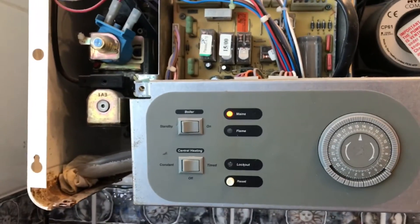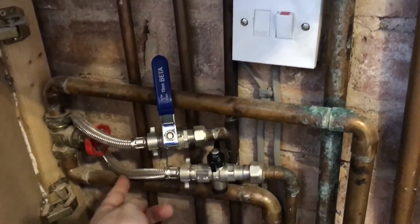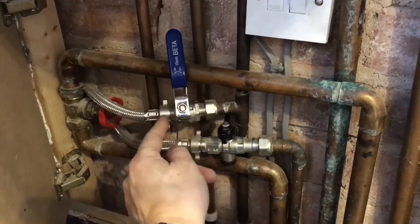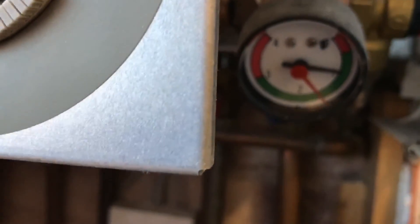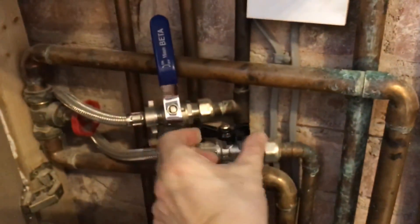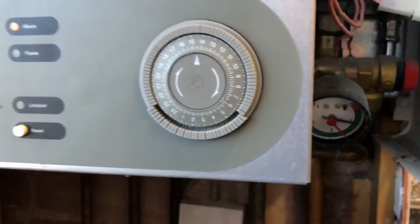Just add a little bit of pressure in the system and everything will be fine. The pressure's a little bit low on the boiler - just to show you what we do: you've got a cold water feed, and these are sometimes disconnected. You've got a non-return valve and a cold water feed. With it connected up, I open up the non-return valve, turn on the water feed and watch the gauge go up until I'm happy with the pressure - I'm going to go for just over one bar. There we go, that's fine, just nice. Lock that back off again, and you can remove the flexi link from the pipe. Happy days - there we have the boiler all back together again, working perfectly. Thanks for watching.